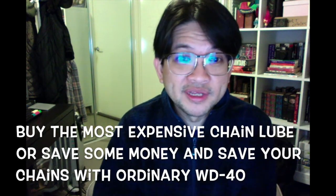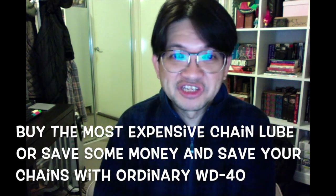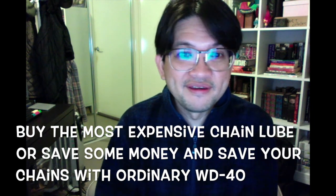Every time you clean your bike, say when you had a wet ride, and of course you clean your bikes, right? Every wet ride, just reapply WD-40. If it's summer and it's not raining, just every 500 kilometers reapply WD-40, and I can guarantee you your chains will last a very long time. If you decide I'm just talking bullshit, well, go ahead, spend more money on the really expensive chain lubes that you can find out there.